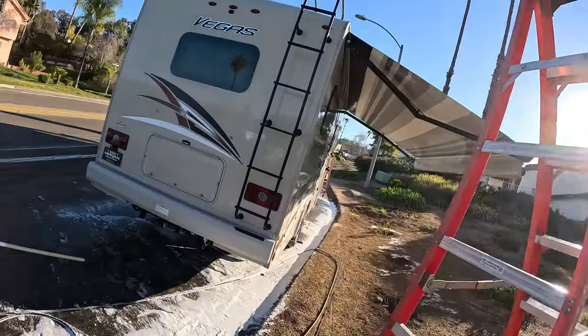Okay, the final step that I'm gonna do for just the wash is I'm going to clean all the windows with glass cleaner and a microfiber, which I'll show you how I do one of them. And for someone at home, like a DIY guy that might be doing this at home, you're probably just using tap water. You cannot wash it how I'm washing it with just tap water. I'm using deionized spot-free water, so I'm able to just wash it and just let it drip dry.